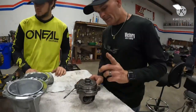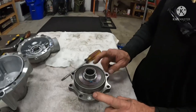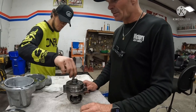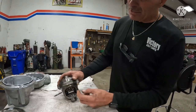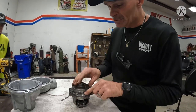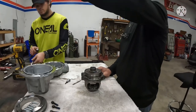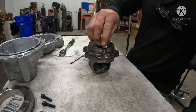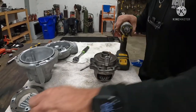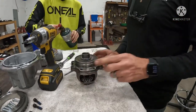The visco lock is inside here. These two small bolts are very very important — they have Loctite on them and will strip very very easily. When pulling these out I always like to throw a little bit of heat on them because the heat will burn the Loctite and allow them to come out easier. If you strip these you'll have to easy-out them. Brandon, get me that little torch with the lighter. Take an impact and put a lot of pressure so we don't strip these things.